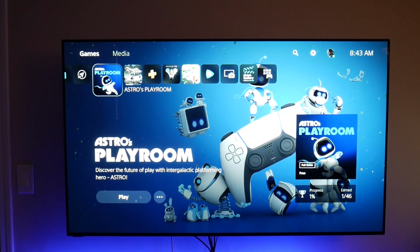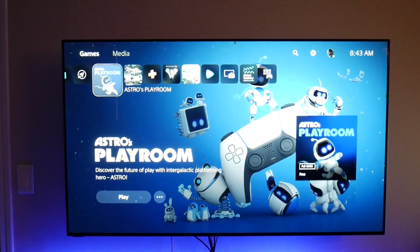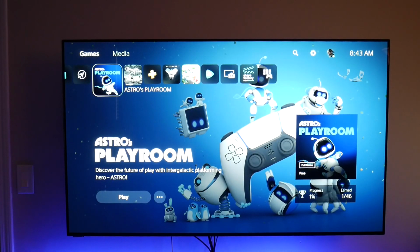BCD here, back with another quick video, and today I want to show you guys how to get a VIZIO to work properly with the PS5 if you just recently got it. I've been going through some troubleshooting steps, and the one thing that actually ended up working is, instead of using the HDMI 2.1 ports, if you use a normal standard HDMI 2.0, it should work fine.